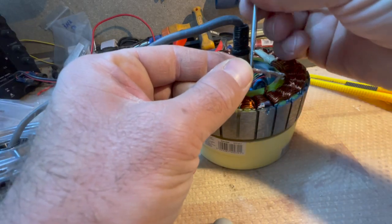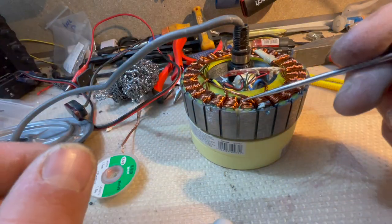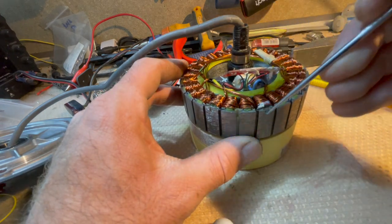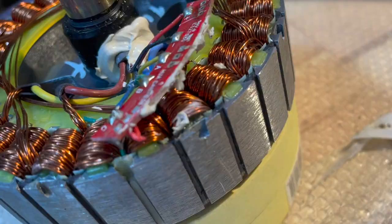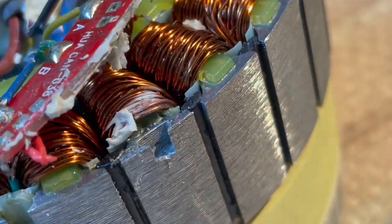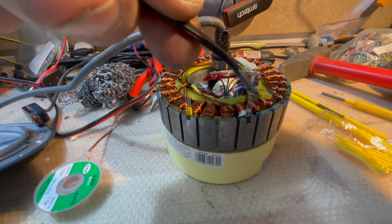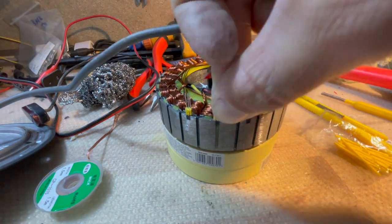Using a needle, shape the PCB connection where the new sensors are connected. Place the new sensors, mind all marking on the sensor to look toward you. Isolate the sensor's legs with some shrink tube.